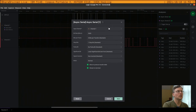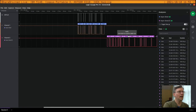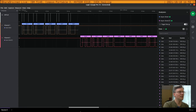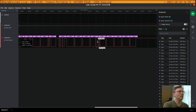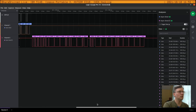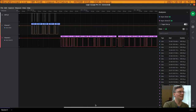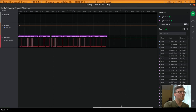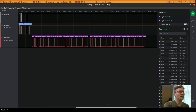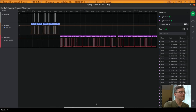Yeah. Channel 2. And there we go. And I have no idea what that means. But it's 9600 baud serial. And assuming that I've got the endianness correct, and I don't know who in today's day and age sends bits in the opposite order that everyone else does, but we've got a run of zeros here, and usually when you're dealing with a binary protocol, zeros happen. And I think we've got something.